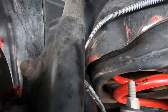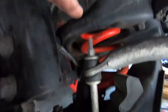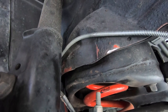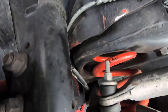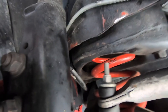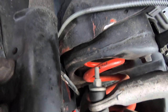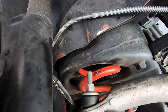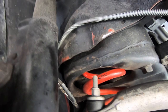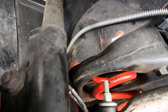And once we get them in, we'll go ahead and jack up the whole thing, make sure that we have plenty of clearance throughout the articulation, and we should be good to go. So drill a couple holes, and we'll have to use the angle grinder and basically cut out that lip. That's not a pretty job. It's hard to do that round sort of work. If you've got a plasma torch, you're probably better off with that tool, but we're gonna use what we have here.